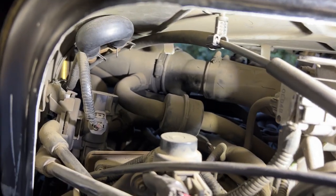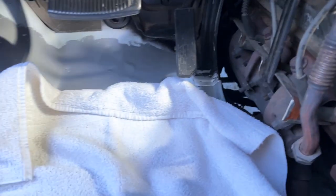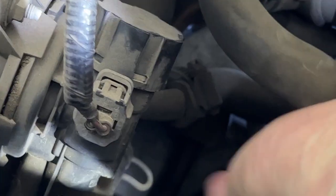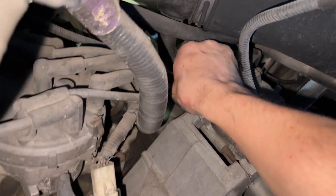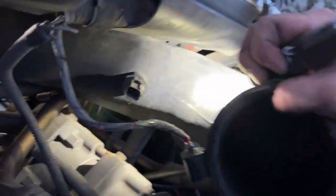This is kind of where it gets a little difficult on the vans. There's the back of the intake hose and we can just try to pull off this hose. Next we've got to pull off this hose right there that goes from the bottom of the splitter on the intake — and that is the oil fill tube. I'm going to try some channel locks to kind of move it back and forth. Got it off — it just needed a little bit of a twist before it would slide right off.